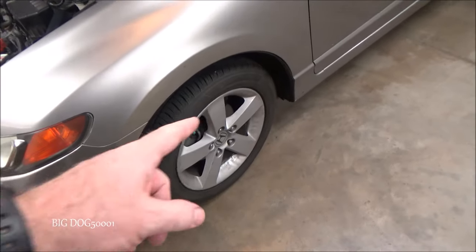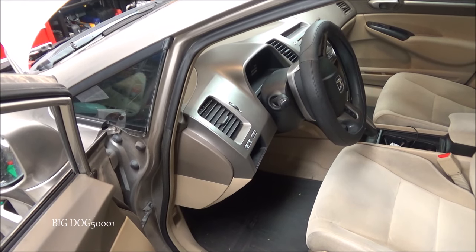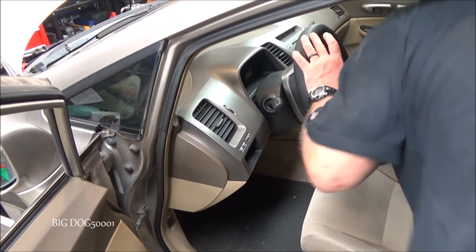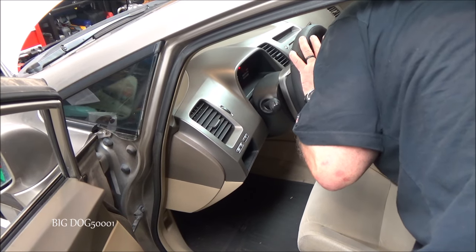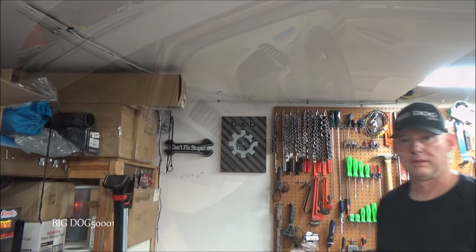The battery is reconnected, the vehicle is back down on the ground, and the wheels are torqued to 80 foot-pounds. Let's see if it starts — I'm filthy from laying on the floor so I'll just reach in. And there you go. That's how I do the starter on eighth generation Civics. It's been a long day and I'm tired, so I cut some shots toward the end — apologies for that. If the video helped you out or you liked it, make sure to give it a thumbs up. Thanks for watching.